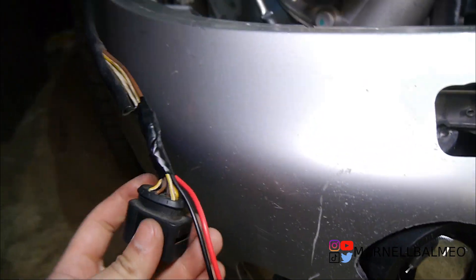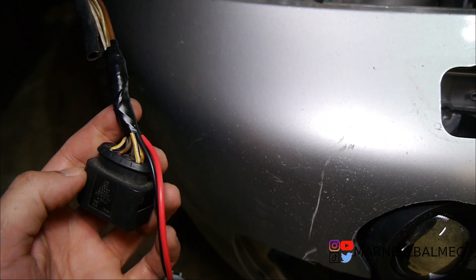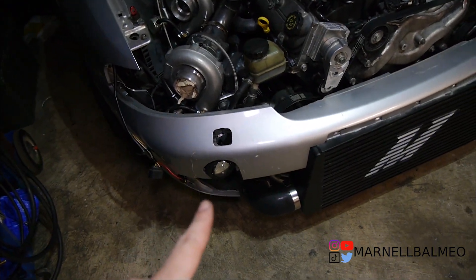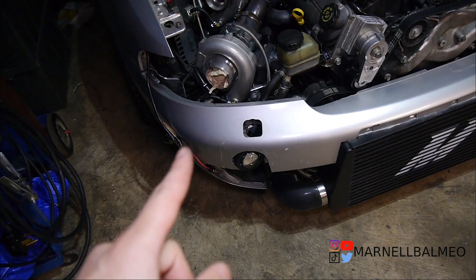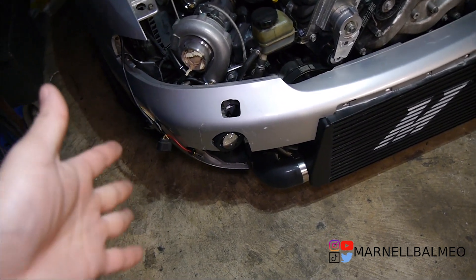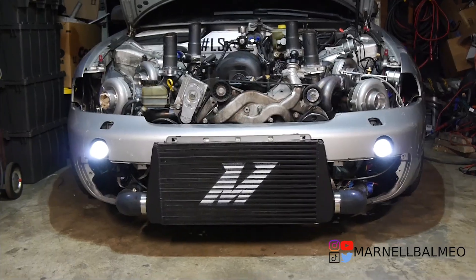As far as wiring is concerned, I grabbed the headlight wiring harness here — I temporarily just put this on, I didn't actually solder anything. Main reason for that is I'm not sure what exactly I'm keeping. I know for sure I'm keeping the headlight. For fog lights I'm not sure — maybe I'll just wire it through a high beam, or do I want a high beam later and the fog light? Turn signals I don't really know yet. So for now I'm just gonna tap in and connect everything.